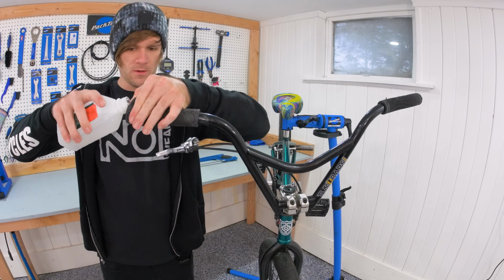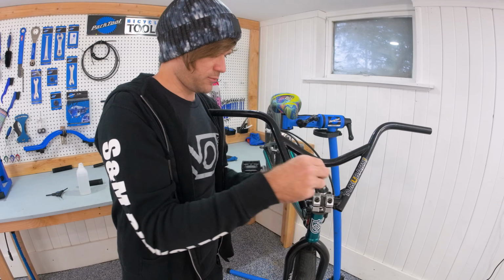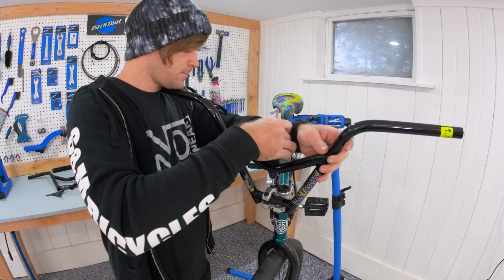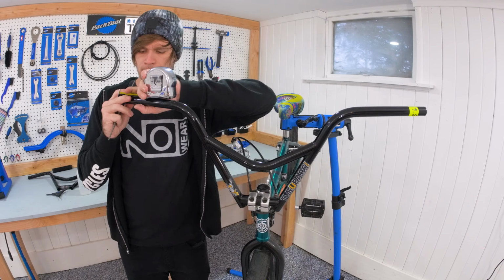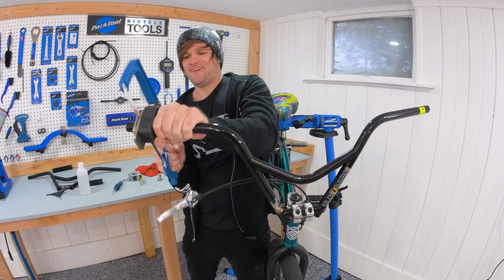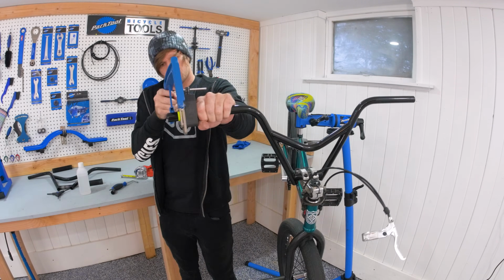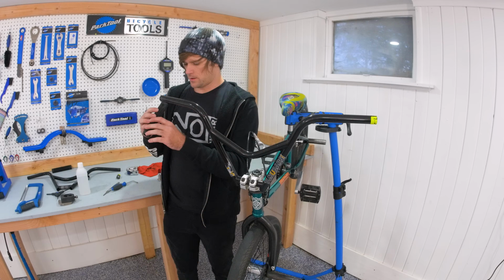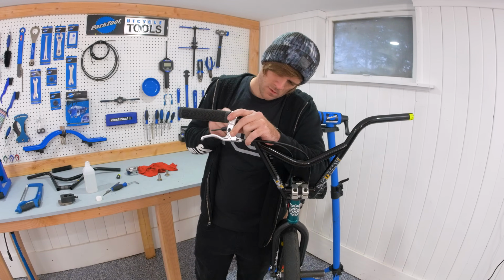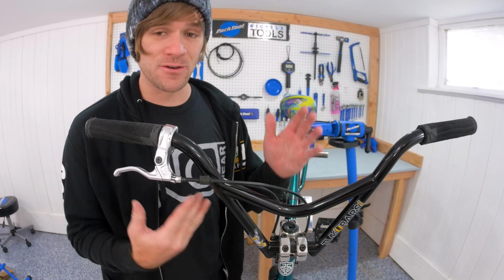I have gone through this process enough times on my channel, so I'll just narrate through the time lapse as it goes. And now we'll take the bars off of here. 27.5 will be the mark of choice. And now for the fun part. And I always make sure to file down. And the bars are now cut. 27.5. Now we can put the grips back on. Bars are installed. And there we have it. The bars are installed, cut, and put to where I like them.